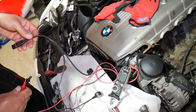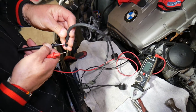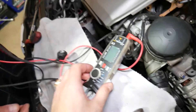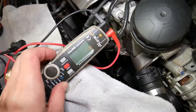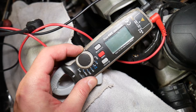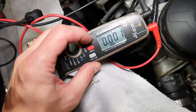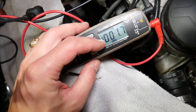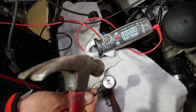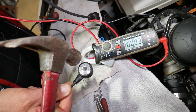We're going to do the right one. Touch one lead to one wire and the other lead to the other wire. Turn the voltmeter to millivolts — this is an automatic one and it's great, we'll share the link in the description below. Click to select DC millivolts. That sensor shouldn't show anything, or very very minimal voltage at rest.